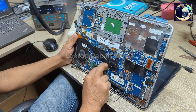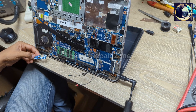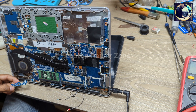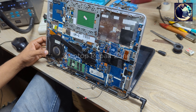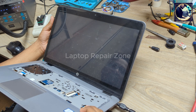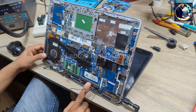Let's try with another slot. Let's plug in again and press the power button — and it's coming on. We have display! So that means this slot is good and this slot is bad.